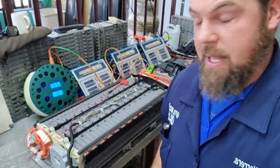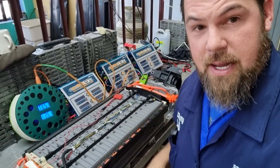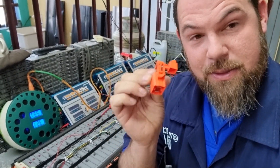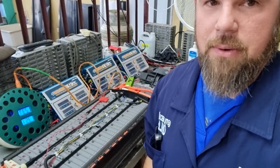I did the warning last episode, but it's always good to be reminded. The service plug grip in this vehicle does not open the circuit anywhere inside the battery. I still don't understand the reason for this. It's about safety — your safety — if you're putting your hands in this type of battery.